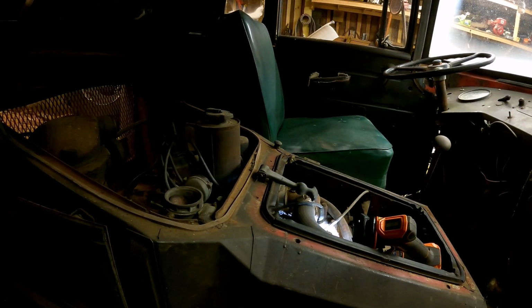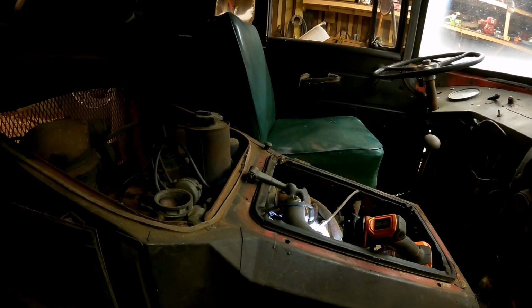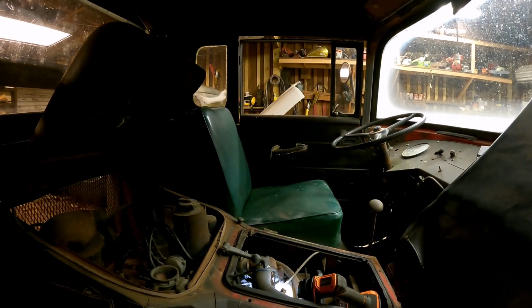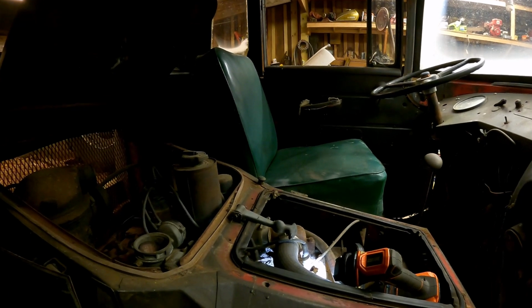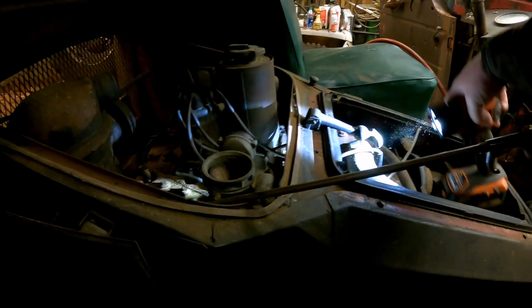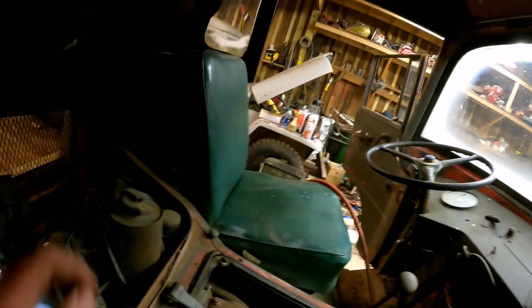I'm hoping, anyway. But I'm going to go ahead and hook the hose up and blow these spark plugs on the top of the motor off. And then we'll see about soaking it with some PB Blaster for right now. And then when we order the new stuff, we'll get a new set of plugs for it and everything. Get this battery unhooked if I can. Man, there's just nowhere good to put a flashlight where y'all can see anything.